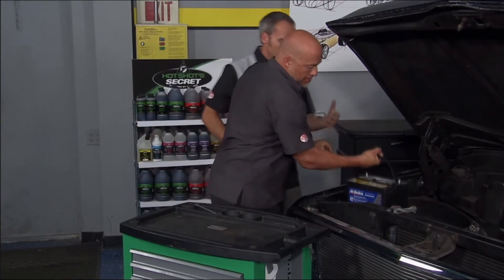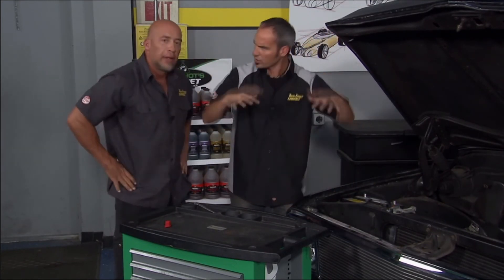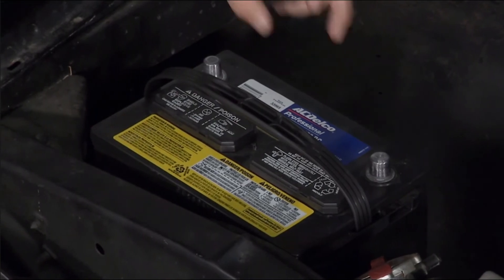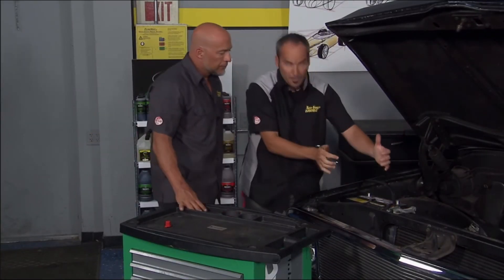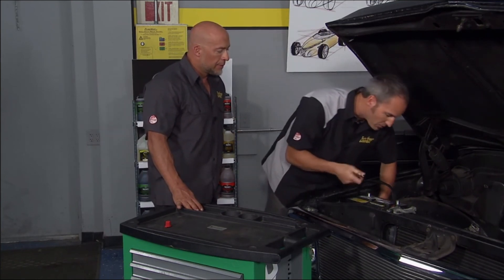We're going for durability here because we've got a truck that's now lowered on stiffer springs, but we still want to do truck stuff with it — so it needs vibration resistance and durability. The casing on these ACDelco batteries is a lot more rugged than a traditional battery. It holds the plates in tighter so everything stays where it should and doesn't shake apart and fatigue over time.